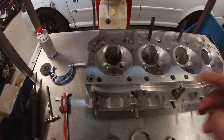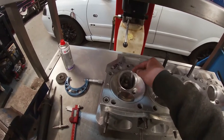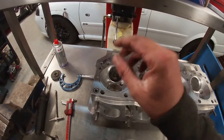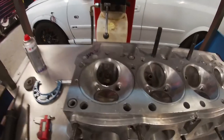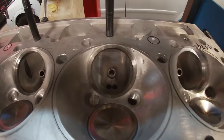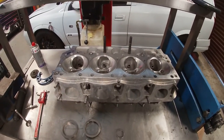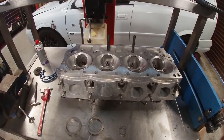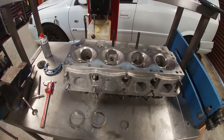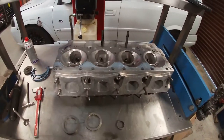The gentleman would like new seats put in, so Tom's obviously bought the seat material. We need to put a new seat in and Tom needs to put a new receiver in. So basically tonight I'm machining the seats and we're going to put them into the head. As you can see there's been lots of repairs on this cylinder head. With a top fuel dragster everything has to be perfect, but from what I can gather it's one run - as long as it survives, take it back, repair what needs repairing, and get out - even if that means welding pieces up.